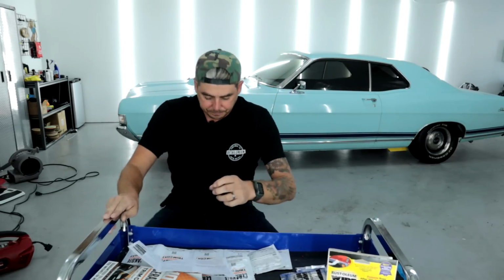One note I wanted to tell you guys. Yesterday I washed the van. So I made sure to wash that fender pretty well too, to see, you know, how it's holding up. The CeraTrim, which is a ceramic infused trim restorer, and the trim cubes from Lithium, which is a graphene infused trim restorer, both beaded water like crazy. Both are looking exactly as they did originally, right after I did it, but they did bead water like crazy. Compared to the Solution Finish side, it didn't, it was pretty flat. So it's definitely not gonna give you the protection that those other two do. However, Solution Finish, as of now, after one wash, still looks perfect. Just wanted to give you guys that update. Let's jump over, prep this panel, and then we'll get going.